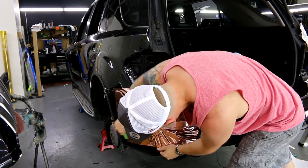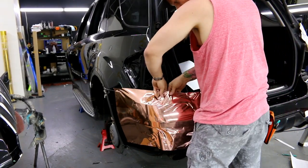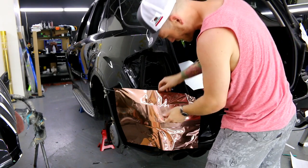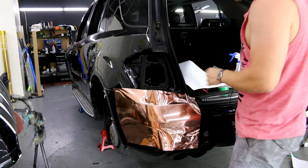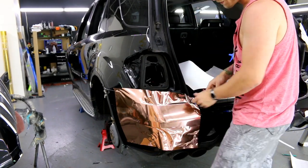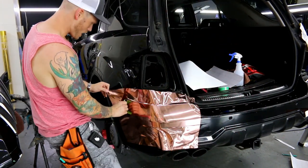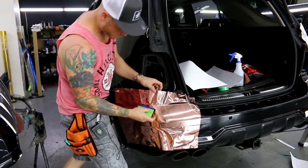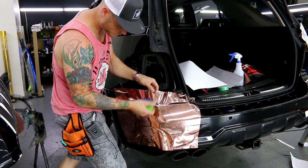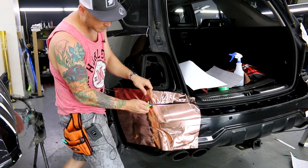Overlays can be used with regular films too — it just really depends. Sometimes you use them on a hood, sometimes on a roof that's too large. So exactly what I mean is we cannot stretch this vinyl up — it's going to distort the chrome finish. We're thinking ahead when we do stuff like this. I have a lot of experience with chrome, so I'll try it in one piece first. I always try to do it in one piece. If that doesn't work, then I try again. In rare situations, I know right away that the film won't make it and I won't even try one piece.